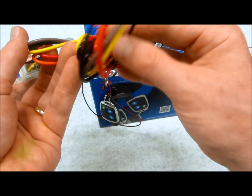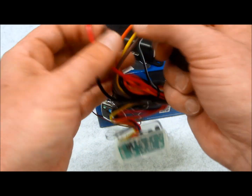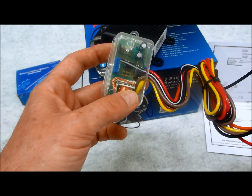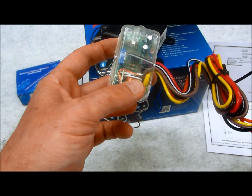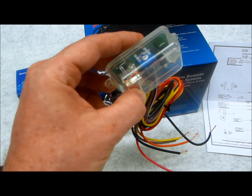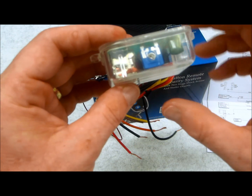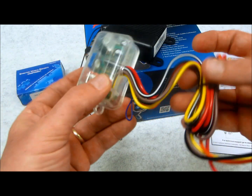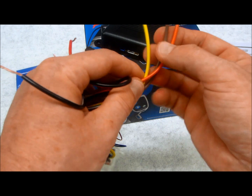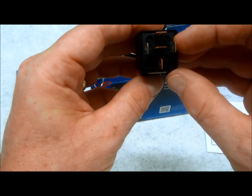What this thing can do is really interesting. You pull out one wire — the black-white — which is the trigger input, and you're left with five wires, just like the five pins on a standard relay. You have power and ground because this is an internally energized relay. It will work with an input that's either a negative or positive pulse, or a pulse resting at either voltage. If that signal disappears and leaves an open circuit, that can also trigger the 528T. On the output side there's an adjustment screw where you can tune the output time from zero to 90 seconds.